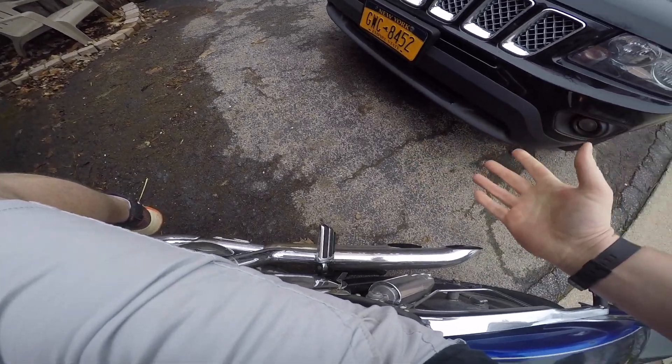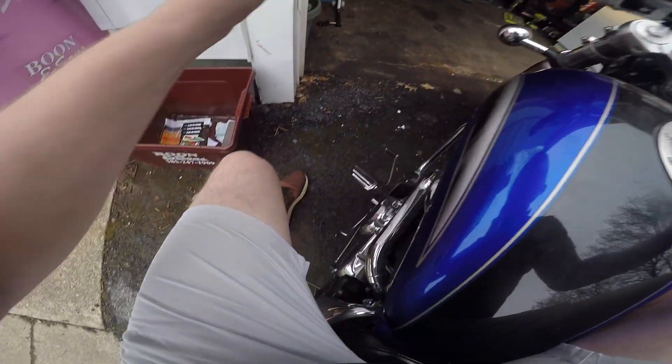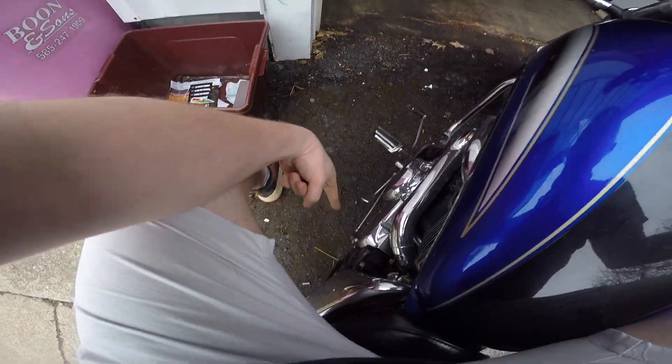We're good to go — oil's changed out. I made sure to clean all the oil off the case; there's a little drop there that I need to clean up. Next step is going to be cleaning off the bike, changing out the front sprocket and the rear sprocket — those are coming in — and the chain is getting changed. There's just way too much play in that as you can see.